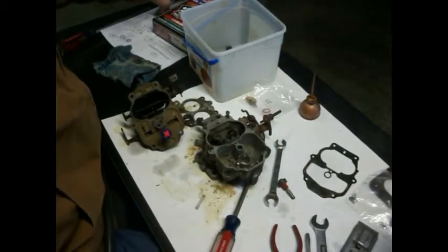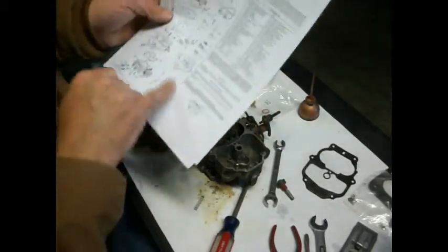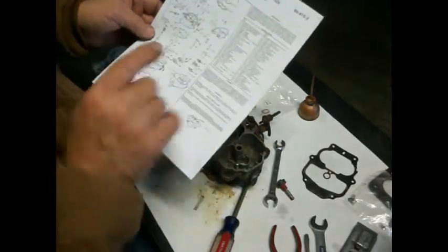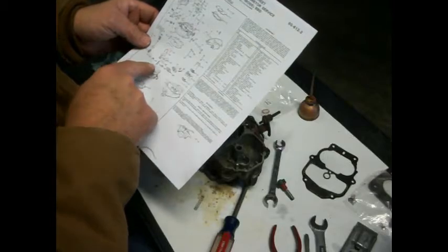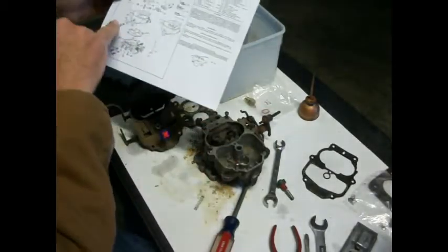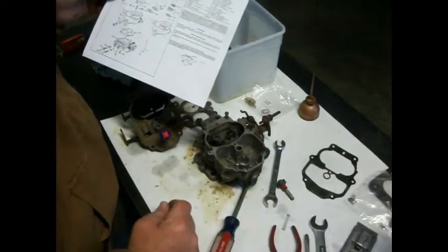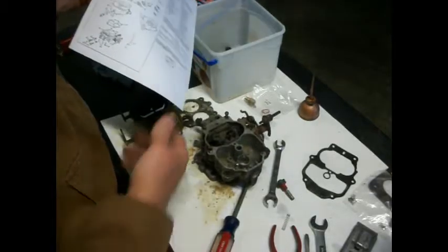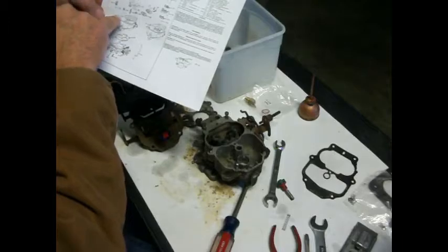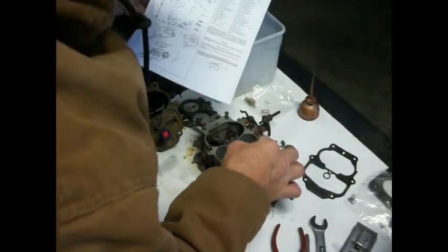Alright, show you more. Okay, well, when all else fails, read the instructions. That ball bearing, I was getting ready to screw up like Hogan's goat. That ball bearing actually goes down in the bottom of this accelerator pump, as shown here. Now, I didn't recall it being that way. Oh, that might be from up here. Let's see. Blah, blah, goes in. No, it says it goes in there.